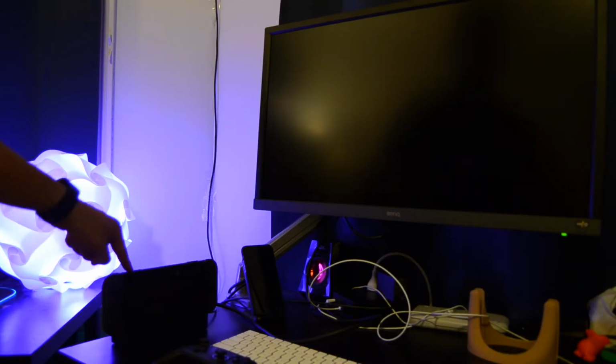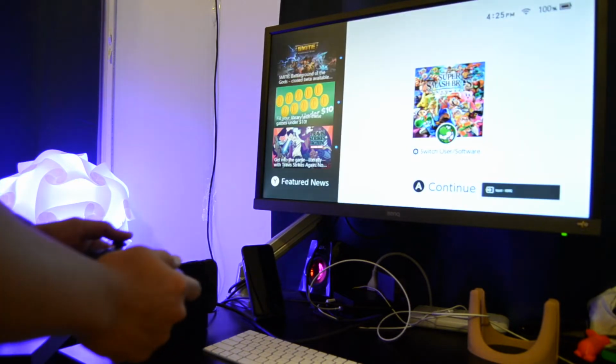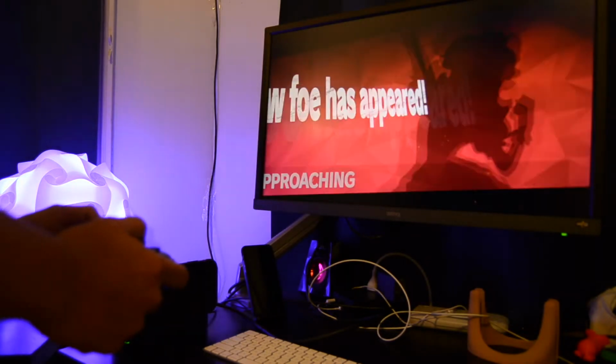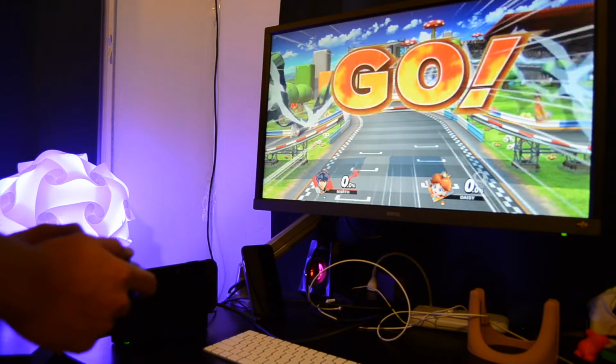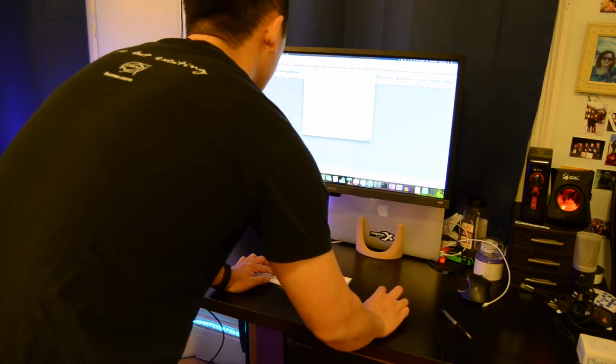Looking past that, my Mac only has an HDMI out, and HDMI only natively supports true 4K at 30 frames per second, or even 24 frames per second in some cases. So I had to do a lot of work and install third-party software to push out 2160 resolution at 60 Hertz through my Mac's HDMI port into the HDMI port in the monitor. This isn't necessarily a problem with the way BenQ implemented it, but having two HDMI ports and one display port means that there's a little bit of a potential for bottlenecking through HDMI on this 4K monitor.